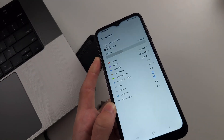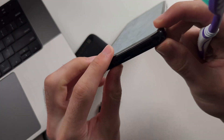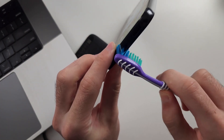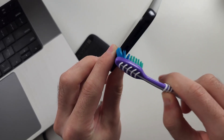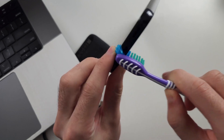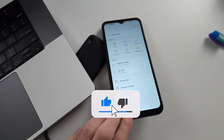Also if it's still not working, your charging port may need cleaning as there may not be a secure connection. Just get an old toothbrush and rub the bristles inside the charging port, give that a good clean, then try again — and that should solve all problems.